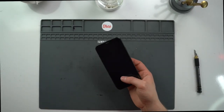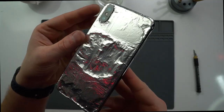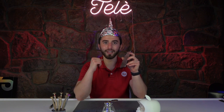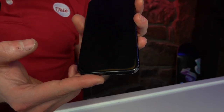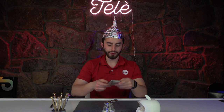And here it is — tinfoil, that's crazy. So just by looking at this phone I can tell exactly what went down: this is a failed DIY attempt. Just by looking at this indent right here, it looks like the wireless charging coil got ripped out of its place. I still see some glass in some areas, and that's not even the scary part — they used so much heat that it went completely through the phone and toasted the front screen.